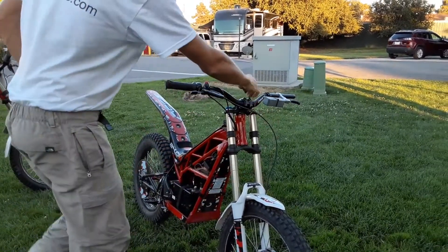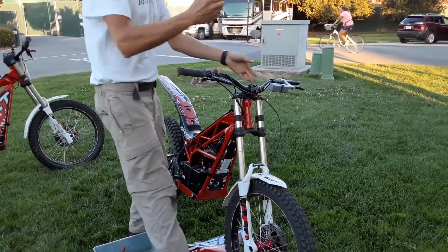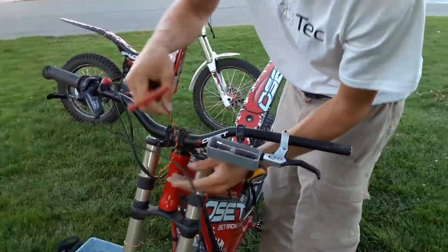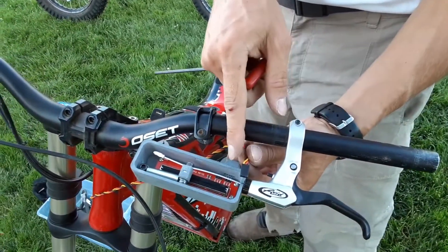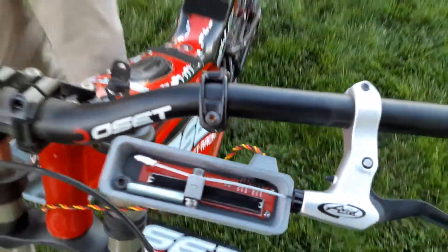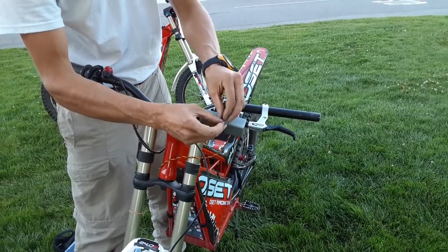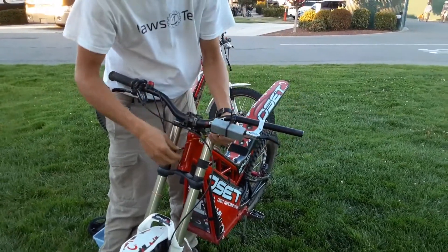There it is, tucked in there. I'm going to remove the lid cover so you can see inside. With the wire routed up, you're going to take the braided wire — there's a cable tension here — and check your color pattern. You're going to have black, red, and yellow. The yellow goes on the outside, and you want to slide it into the hole and catch all three pins. I'm going to use this little pusher stick just to engage it. You can see it's properly engaged. Once it's engaged, I'm going to snap the cover back on and zip tie it in place. The zip tie is not required for the snap cover, but I'm doing it since I cut the snap cover lid earlier and need it for tension. Clutch kit's installed, wire's nice and out of the way.